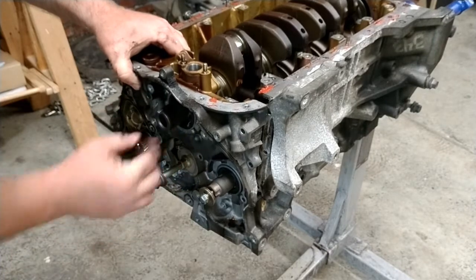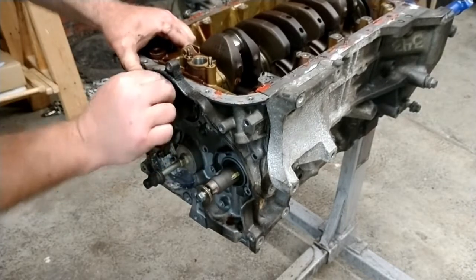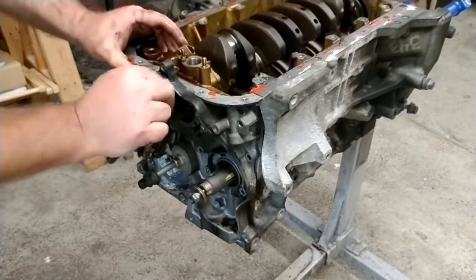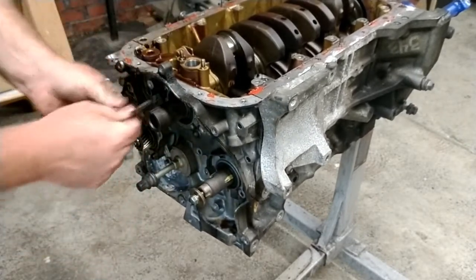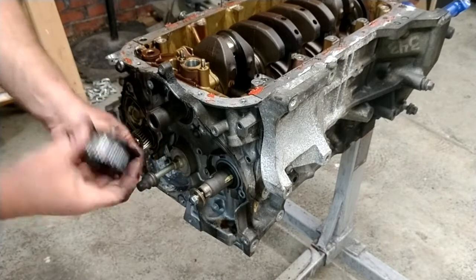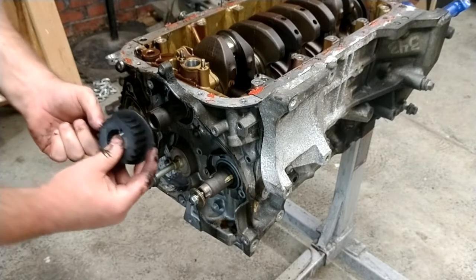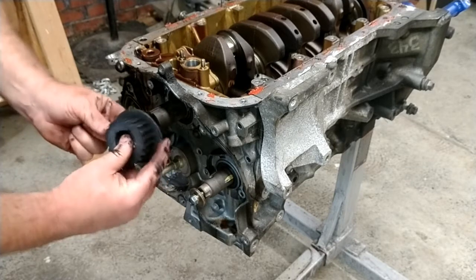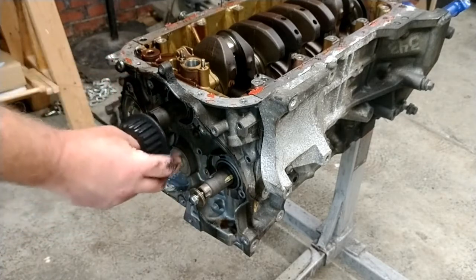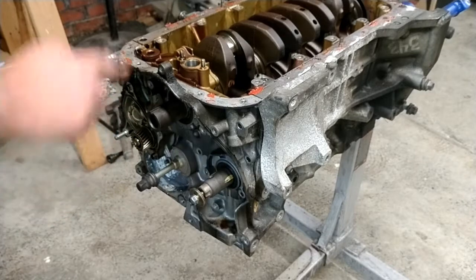This is off now, and this key here on the crank — you definitely want to keep up with that. The keyway fits into the crank and makes sure all the pieces stay locked in their same position. And this around the back is part of the crank position sensor — as that thing spins it's counting on either side, very quick. The magnetic pickup keeps up with that. Let me put this key in a safe place; we're going to come back and get the rest of this off.